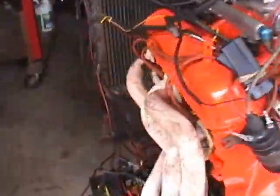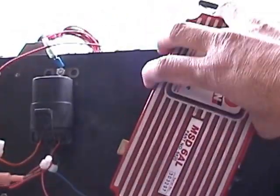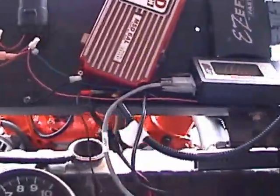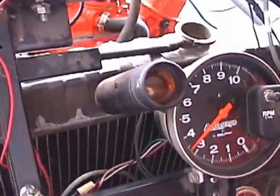The Easy EFI needs a tach adapter. They were including an MSD unit when you first bought it; I'm using an MSD I had on the shelf because my tach adapter went with my kit on my 440. I had the Mopar ECU on this engine and had to use the MSD just to get a clean tach signal. I only have one handheld between the two Easy EFIs — once you get a tune dialed in, it self-tunes and you don't even need the handheld anymore.